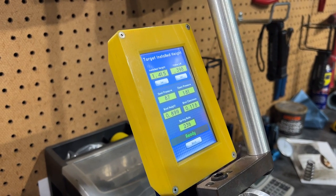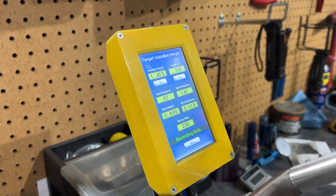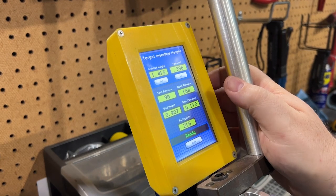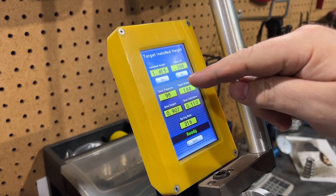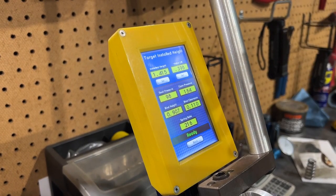Now we have the second additional spring. Nice seat pressure — 98 pounds. 184 open. We're 110 thousandths from bind with a 216 rate. That means you can run a little more boost, but you can't run as much RPM with this one. It is what it is.